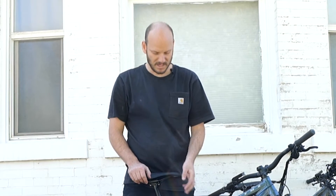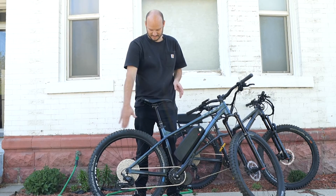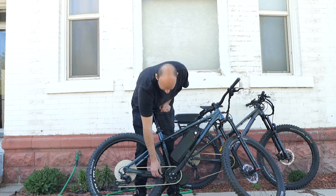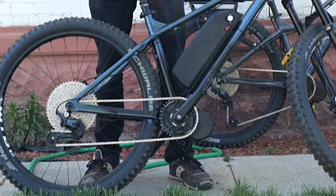This thing I've noticed is about 28 miles an hour that you could pedal before you start looking like a cartoon character with this 36-to-11 gear ratio. So the best thing is figure out how fast you want to be riding while pedaling. If 28 is fine, go with the 36-tooth. I love this chain ring. With the O2, it does not have any offset though, so just be careful. This fortunately worked out where I'm still able to ride in this lowest gear without it popping off, because it has that thin narrow or fat narrow tooth profile where it grabs onto the chain super well.